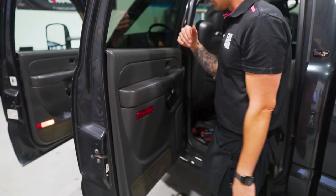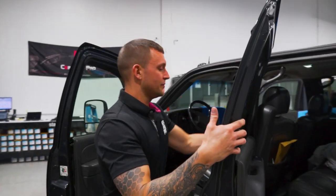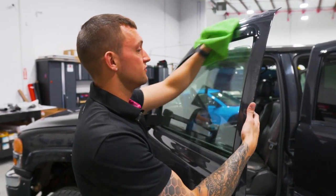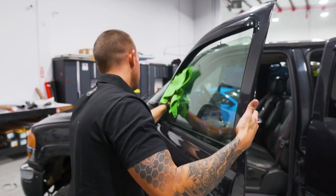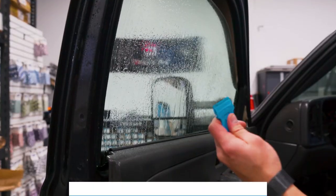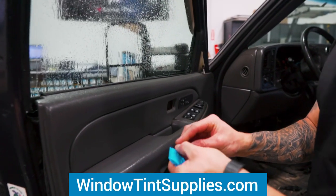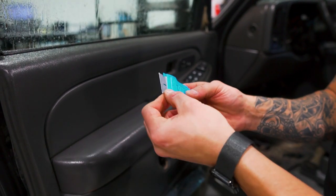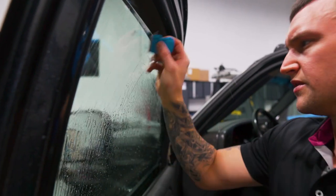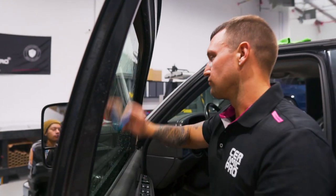Slide the bottom back in place leaving the top away. We'll do the outside prep, inside prep, and then lay out the pre-cut pieces. It's always a good habit to wipe the inside of the rain guards so nothing drips from there. Inside prep: spray, razor, spray, squeegee — spray back in stock at windowtintsupplies.com. Single edge razor blade holders and .009 American line blades. Quick once over to make sure there's nothing on the glass, especially these older trucks where you don't know if there's been tint on it before.